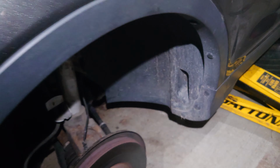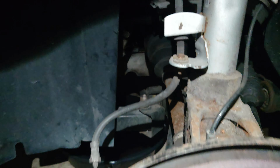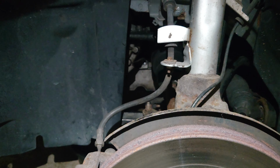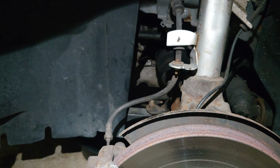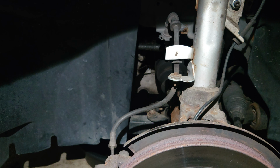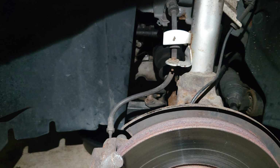So now, our overfill bolt, or leveling bolt, whatever you want to call it, it's further down there, but that way the car is level, so that way one part of the engine isn't sticking up, screwing up our level and preventing you from getting an accurate fill.